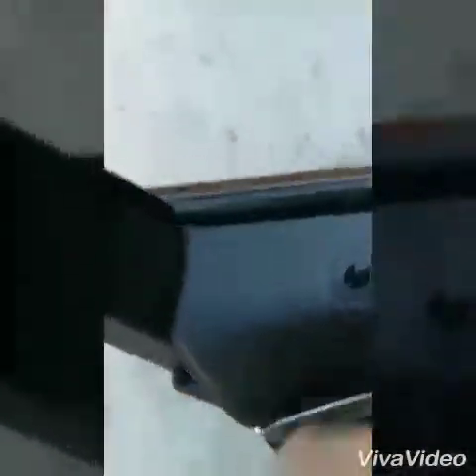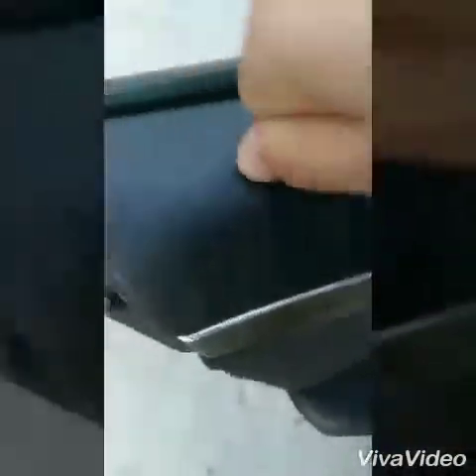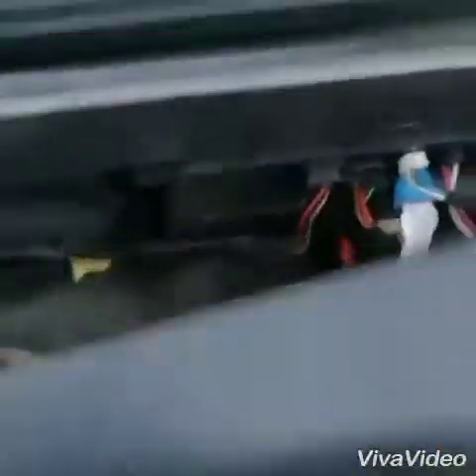Remove the plastic holders — easily. Once it's removed, you pull up the door panel. And of course you have to remove this one too. Once all the screws are removed, just pull out the panel like this and it will be off.